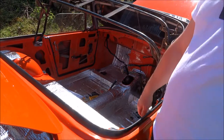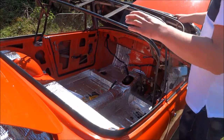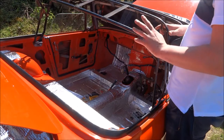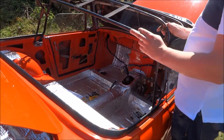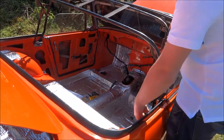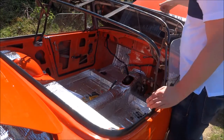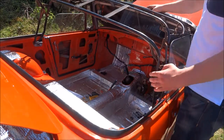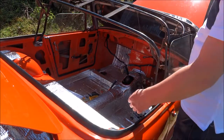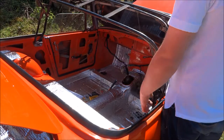little brackets sit on the end and then the gaskets and everything else. If you can't, you can do it on your own. I've managed to do this on my own, but it is useful if you get somebody to help you. If you clip them in first, once you've got one bolt each side in, and then afterwards clip this in so it's level and straight, then you can start to bend this out a bit and then put your second bolt in, because the mechanism inside moves, so it's easier to tighten up.